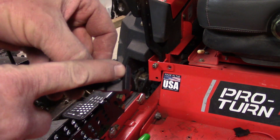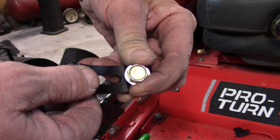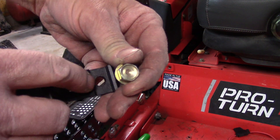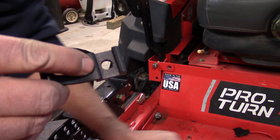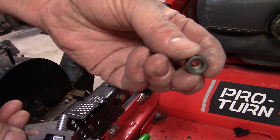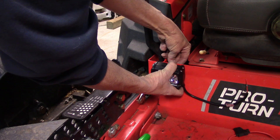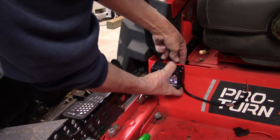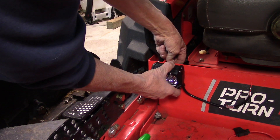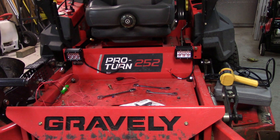Okay, I was just going to drill this out and grind this off, but I got to thinking: that's got a shouldered bolt on it, and even if I ground it all off, it'd still be hitting that. So I had to come up with something different — I'm just going to go with a smaller bolt. I'll probably have to hold the screwdriver up in there, with just a nylock nut on the back, and that'll bolt it right up without a problem. I don't like how the lights are pointing down, but we'll see how they work when it gets dark out in a couple of hours. The project will be all done and I'll see what it does in the dark.